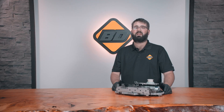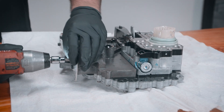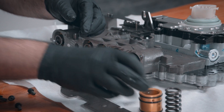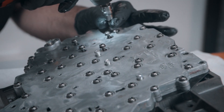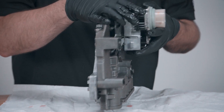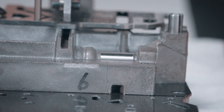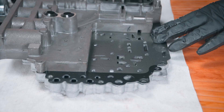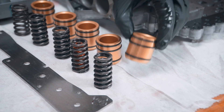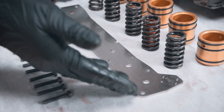Let's open it up and take a look at the pieces that will help increase the life of your transmission. BD's remanufactured valve bodies come with a sleeved solenoid switch valve bore and oversized solenoid switch valve plugs to prevent overdrive leaks. The BD bonded separator plate eliminates cross leaks and handles increased line pressure. The new valve body includes new BD accumulator pistons with improved sealing and also a heavy-duty accumulator plate to prevent accumulator blowout.